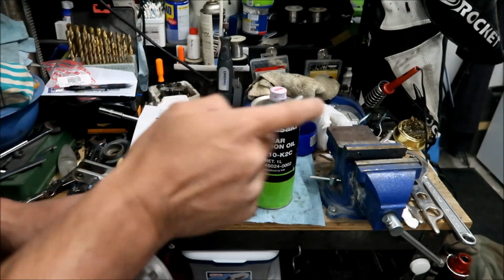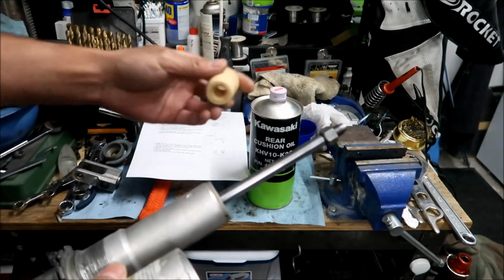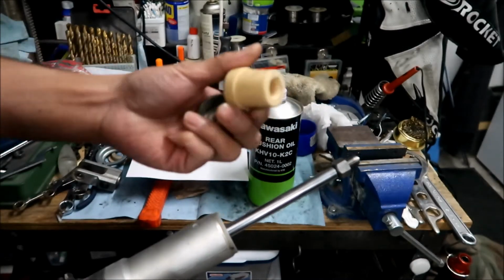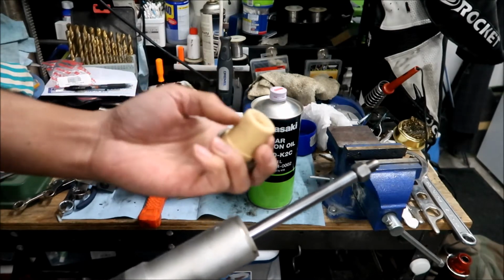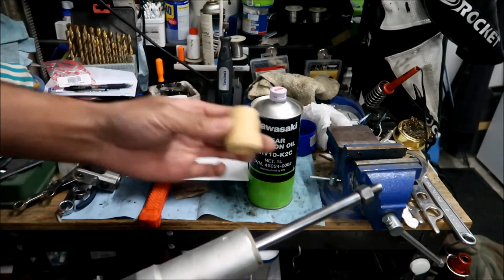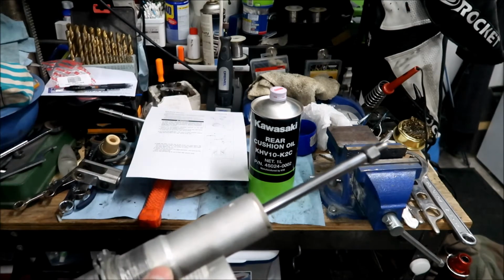I will be removing this nut and then adding this guy, okay? All this stuff should actually be on here already, but mine was missing. If yours doesn't have this, buy a new one. I'll put a part number in the description of this video if you are missing this. You need this, okay? It keeps your shock from bottoming out all the way.